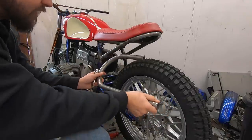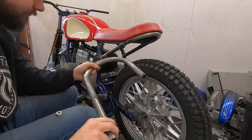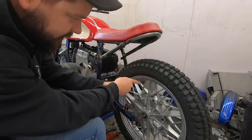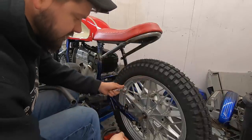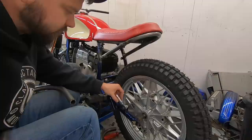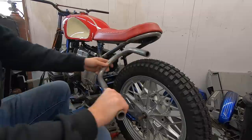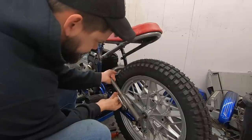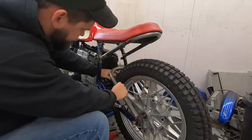I'll get some thick-wall tubing and bend up a hoop, probably about this long total. I can use these heim joints that we already had — I've already machined up an adapter so the heim joint slides right over the stock lower shock mount on that side. I can use a little spacer that allows us to use the factory mounting bolt location, giving us a nice mount. I'll bend up a hoop that will terminate right into those heim joints on either side. Then I need to figure out how to connect the front of this hoop to the front of the swing arm.